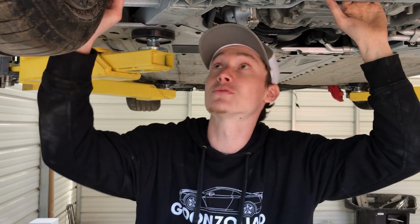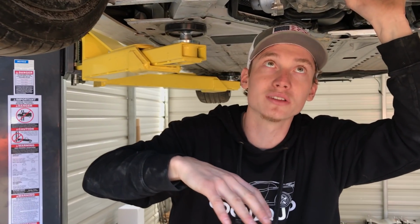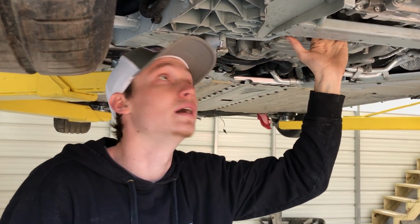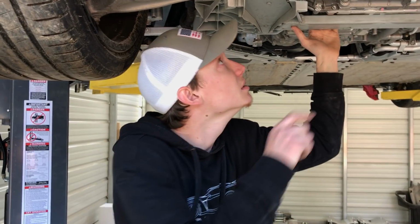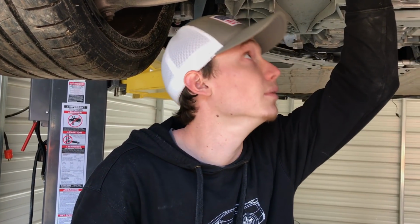We may have to remove this wheel and try to get it through the side. If not, we're gonna go ahead and lower the car and see if we can get it through the top. That'll probably be the best way, but it looks to be so cramped up in there that I don't know. We're just gonna have to look around and hopefully can remove that thing and test it out because it's just clicking. Maybe we should go up into the car and you hit the starter button, and see if it's coming exactly from that area before we actually dig into it. I'll probably put my hand on it and see if I can feel it even moving once it clicks, you know, because that's a pretty hard click.